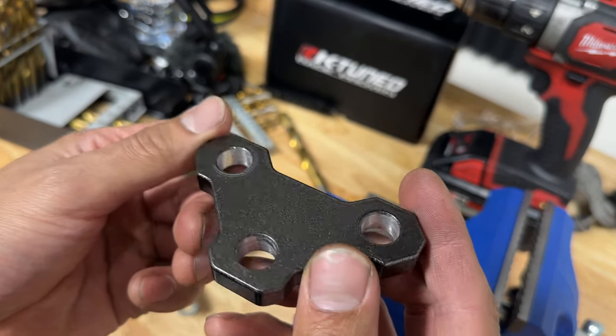Now there are a few things I disliked about these ball joints. First, it was pretty inconvenient to have to drill out those three holes on one of the plates so it would line up with the ball joint and allow me to screw in the bolts. I only had to do that on the passenger side, but those little things make the project take longer than it really should. Second, the castle nut and cotter pin design — when you compare it to the OEM castle nut and cotter pin, the OEM is designed so the cotter pin doesn't hit the axle. But on the K-Tune castle nut, you have to fold the cotter pin over itself, and before it even folds over it's going to hit the axle. You've got to finesse it past the axle and then it's going to be a lot harder to remove when you go back in there.